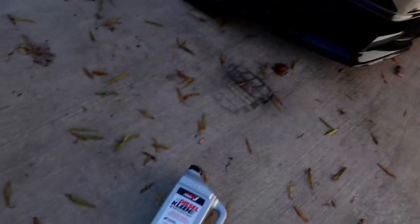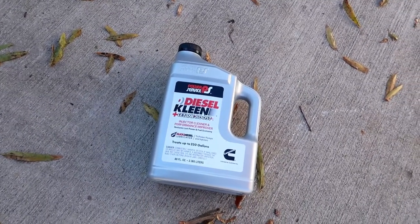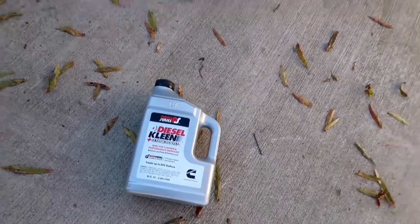I put about a couple gallons of diesel in there and a majority of it is Diesel Clean. This is actually the cleaner we're using today — I've got Diesel Purge coming on Saturday, going to do the same kind of setup with that. The idea is I'm super-dosing some cleaner in there to try to loosen anything up, let it sit and burn most of it through, then let it sit overnight and hopefully it eats up whatever's in there. If you guys are thinking about doing this — it's a little bit of a pain but you're saving like three grand. I've got a day to put into it, so we're going to try it out.